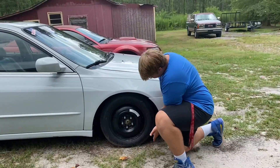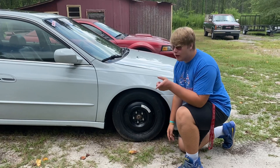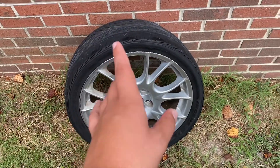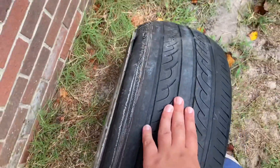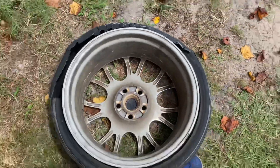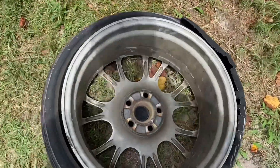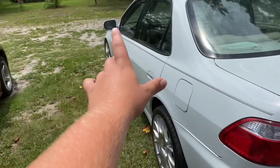Let's get straight into it. As you can see here, there's a donut on the front instead of my BBSs and I'm going to show you what happened to those right now. This right here is my BBS CK — I think it's a CK series. The tires that were up there, the car was out of alignment, so it was eating up the inside of the tire and I never knew it until eventually that happened. And if you can see, that's the sidewall of the tire where it had separated and I lost the tire at 75 miles an hour on the highway, and that kind of screwed everything up. But this was the most recent thing to go wrong with this car.